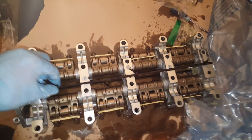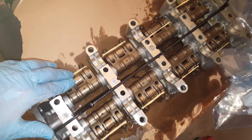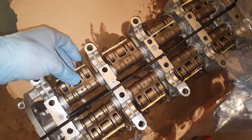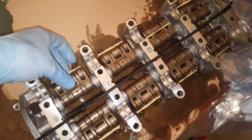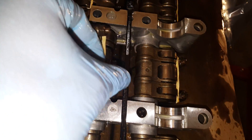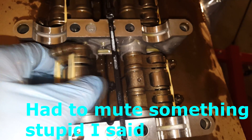I've completed mine — I also added zip ties to the whole thing so that you can pick up the whole assembly without it coming apart. One thing I like to do is check that the middle rocker can move freely without the other two. If the other two start moving with it — not just from friction, but because the pins are connected — then you did something wrong and need to go back and check it. Also, the nuts are on top on the outside ones, and on the bottom on the middle there's a little nub. If you liked the video or if it helped you out, please give it a like, and if you like videos like this, please subscribe.